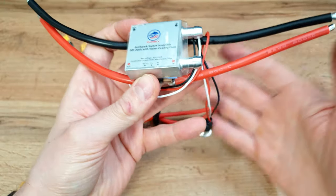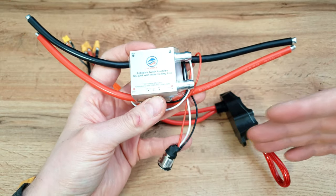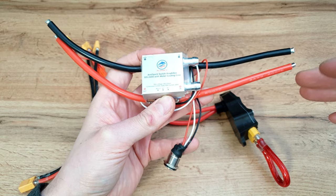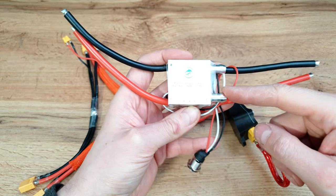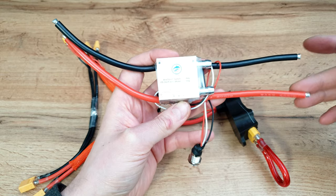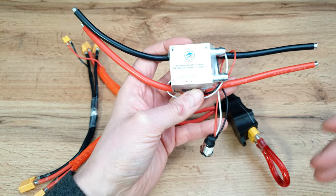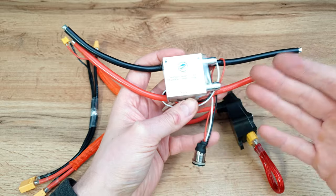So why should you even consider this kind of stuff? Let's imagine that you are modding your e-scooter — like doing some shunt mod on stock controllers to increase the power, or you are changing the controllers and you are not sure if the system will survive. Thanks to this simple button you are sure that your scoot will survive, because it's connecting the battery to everything else. So if your controllers catch fire or there is a short circuit, you can easily disconnect the power.